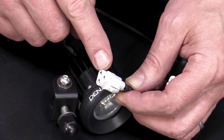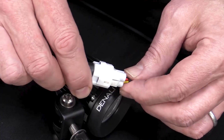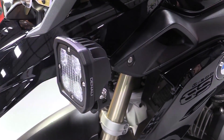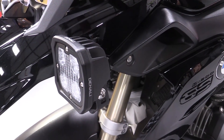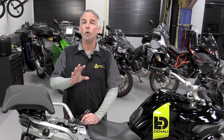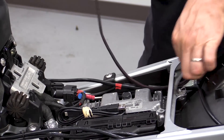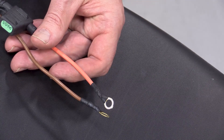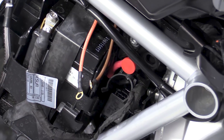The lights all feature three-wire dimming. Two of those wires carry power and ground, and the third wire carries a control signal to tell the pods to dim on command. This is a more stable way to control brightness than by pulsing the input voltage, and it's compatible with any lights that use three-wire dimming, not just the Denali brand. With the CanSmart, the only real wiring of consequence is to connect the battery harness to the battery itself, and even that uses a pair of pre-installed ring terminals. So if you've installed a battery tender harness or a pigtail for heated gear, you've already done the hardest part of the CanSmart wiring.